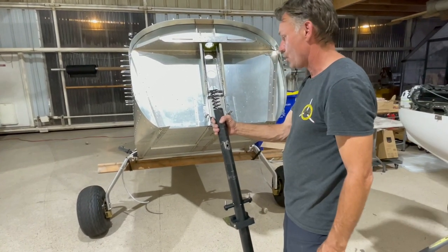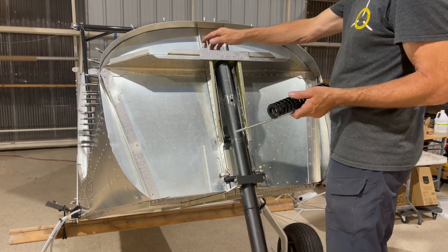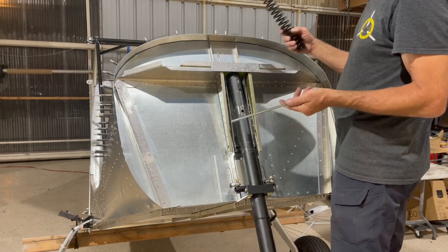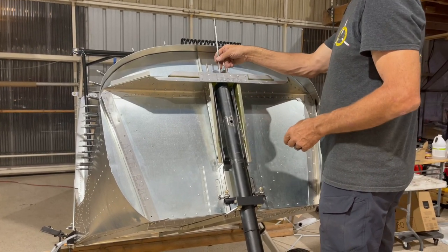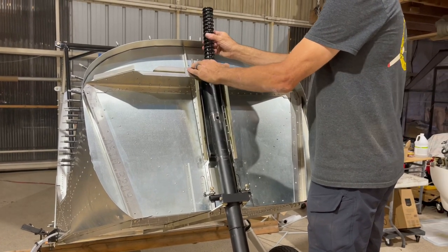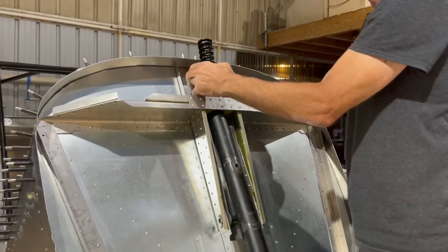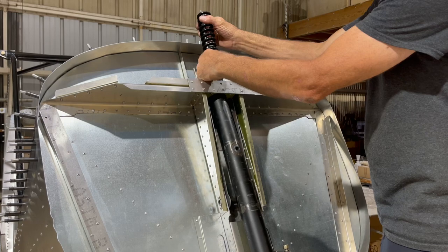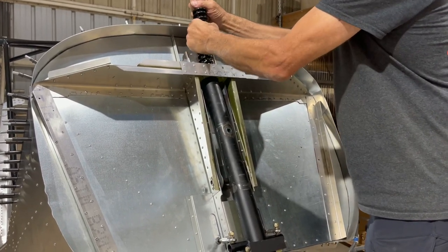Once that's done, we'll show how to install the top saddle. Now, let's say the nose wheel is installed to this point — this makes it a little harder to install. You can trim this back a little bit or just hold it forward. We're going to put a washer down on there; that's what the spring is going to sit on, and then that can go down inside. Rotate it until it sits on this tube. The spring goes in — it goes inside the tube, then hits this. You can bend the spring slightly as you move it down, or hold it up here and feed it in all at the same time.